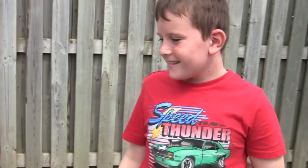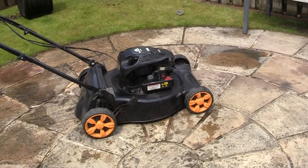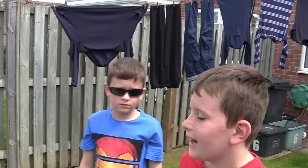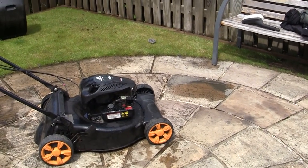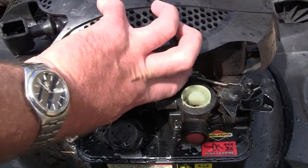We're not going to make much money out of this, are we? No. What do you think of that? Not so far. Well, how can you sell that to somebody and say you've been using it and it all works all right? It doesn't work all right, does it, Jack? No. Was it running fast or slow? Fast. Too fast. So what we're going to have to do is get some governor springs and put them on this carburetor.